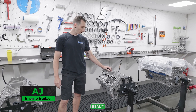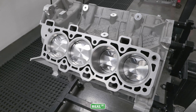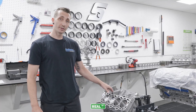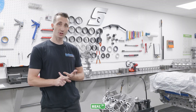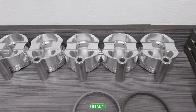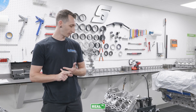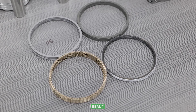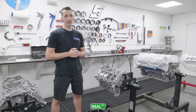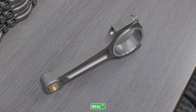AJ here with Fast Forward Race Engines. I'm going to show you one of our Coyote blocks — this is a Gen 3. We'll go over the difference between our Stage 1, Stage 2, and Stage 3. Stage 1 builds use a stock Boss crankshaft and an H-beam rod. All builds use the same wrist pin and piston — a Manley piston, either 10-to-1 flat top or 11-to-1 with a slight dome, with upgraded ring packs. The pin is a 210-wall pin that can handle all the power and boost. Stage 2 is a sleeved short block with a factory Boss crankshaft and an upgrade to an I-beam rod.